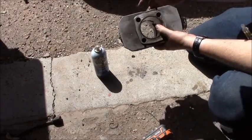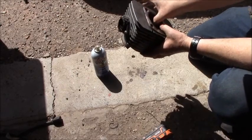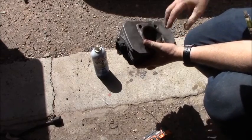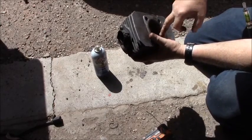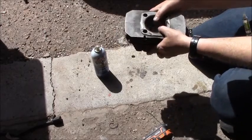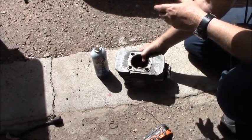Just gotta clean really well. Clean the cylinder really well — hot water, soapy water. Make sure when you're checking it, get a brand new paper towel, run it really hard against the bore. If it comes out white, you're good. If it comes out dirty, you need to scrub some more. That's basically all there is as far as honing goes for re-ringing. It's quick and it's not that hard to do.